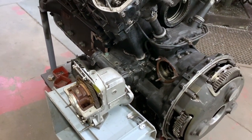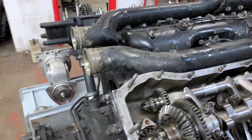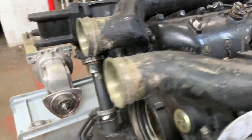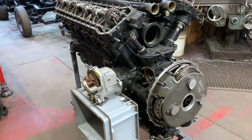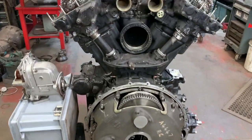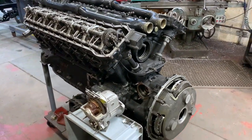You then move the engine onto the seven degrees further retarded position for the magneto which goes on the other side of the gearbox. That magneto goes up in between the V harness and fires the plugs on the inside or intake side of the bank. This first magneto I'm just about to fit fires the plugs on the exhaust side of the engine. So it's relatively simple to set up the timing on these things. The supercharger isn't fitted yet — in this instance it's a bit easier to fit the trailing ignition harness across the back without the induction pipe from the supercharger. We'll get both mags fitted and then get onto fitting the supercharger.